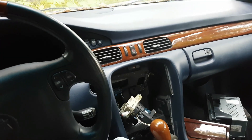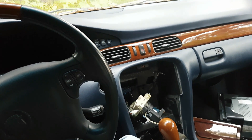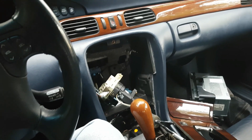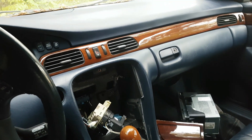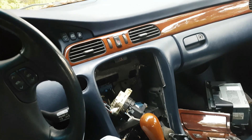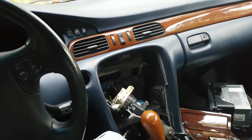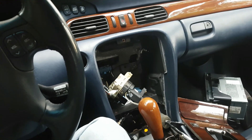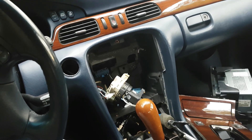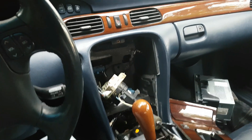The car doesn't have very many kilometers on it — about 120-something thousand. Since I replaced the ignition switch seven or eight years ago, this current switch would probably only have about three or four thousand kilometers on it. But these cars are notorious for electrical gremlins, and almost 90 percent of those gremlins in these cars are caused by this ignition switch, because of the voltage that goes through it for the Bose amp and all the other high-end electrical components — it all travels through this ignition switch. The only other possibility is a bad ground or the computer, but computers generally don't just flake out.